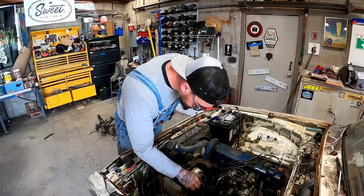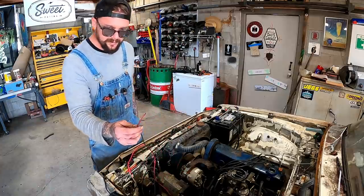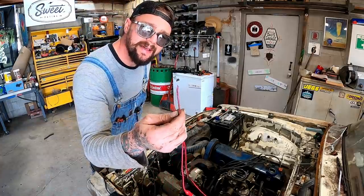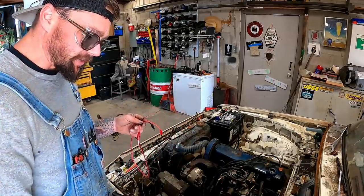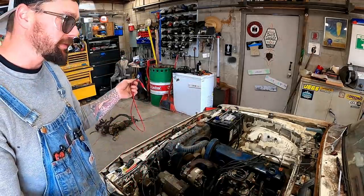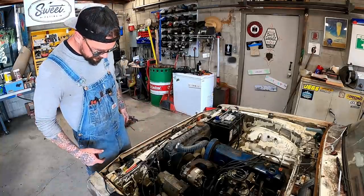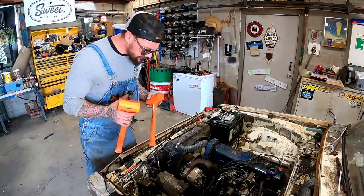Uh-oh. Hey, looky there. Something's going on. Look how we just melted that clean out of there. If I was a betting man, our jumper wire's back feeding a lot of stuff and it's power, but there ain't nothing on. What the hell? We'll worry about that in a minute. We're gonna get this distributor free, or we're gonna break it trying.